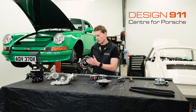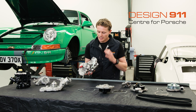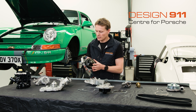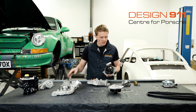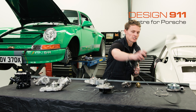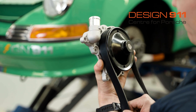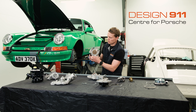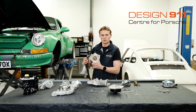So those are the main ways a water pump can go wrong: either the water seal fails and water leaks out the front, the bearing fails, or the impeller starts degrading. The key component is the pulley or hub, which drives the water pump via a belt. The belt goes around the pulley, other ancillaries, and then around the crank. As the engine rotates, the belt drives the pulley on the water pump, which rotates the impeller and pumps water through the system.